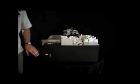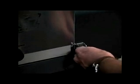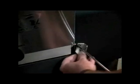The majority of components on the DTG are going to be on the control panel side. We need to start with removing this black panel. There are nine screws that hold this panel on, starting with the front side. We need to remove the screw that holds the tray bed lock — just remove the screw and the whole lock assembly. We have one screw down here at the bottom.